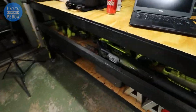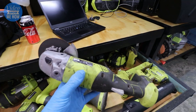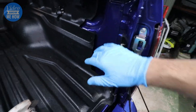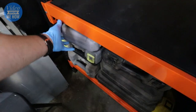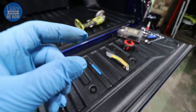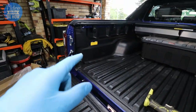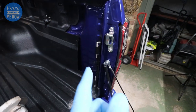For cutting, there are a couple of options. A standard Stanley knife works well. Alternatives would be an angle grinder - if you do use one, be insanely careful and make sure you pull away the tub so you're not cutting into it; that's a little more adventurous. The other option is a Dremel or rotary tool, which lets you get really fine with those tiny mini angle grinder bits and cut it out nicely and easily. It's up to you depending on what you have on hand. Our next step is to clearance the tub section so we can install the bracket.